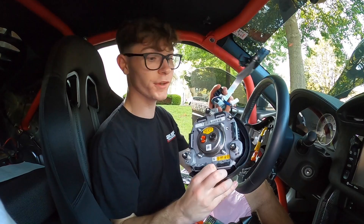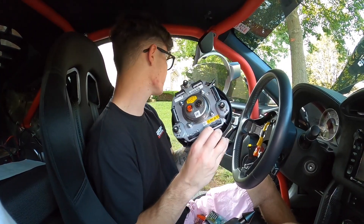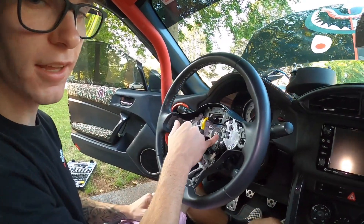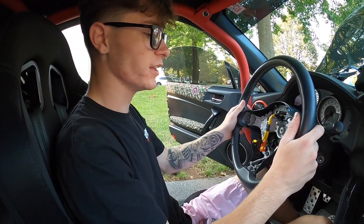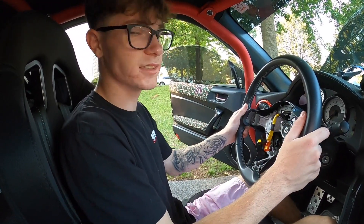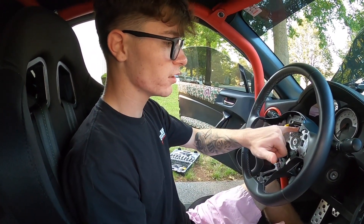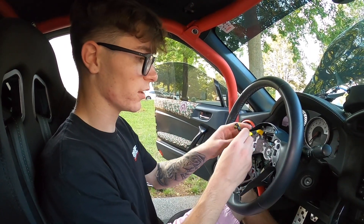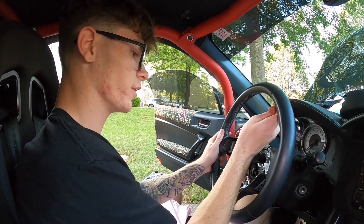I honestly couldn't get this piece off — the YouTube video says it comes right off but I couldn't do it, so I had to take this whole piece off, which is okay because both pieces are going onto the new steering wheel anyway. The next step is to grab a 17mm socket and loosen the center bolt almost all the way, so you can get the wheel out of its place but the bolt stops it from hitting you. Then finger-tighten it off. And the clock spring — very important — don't mess with that. Just let it be and unplug the wires before you remove the wheel or it'll be an expensive fix.